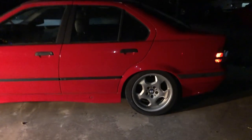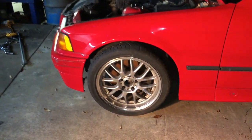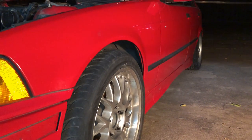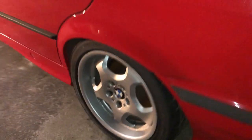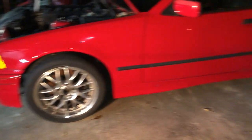Here's what it looks like currently. That's the back with no height adjuster, just the spring and then the rubber pads to dampen some of the vibration and noise — since like I said this is going to be a street car. And here's the front without adjusting anything. Right off the bat I can tell the camber is close to zero, the plates are kind of in the middle. So I'll be slotting those toward negative a little bit and I'm probably going to drop the front maybe about an inch because I want it to have good fitment but still be very functional. It'll probably never be lower than this in the rear because I want to be able to do flares later and clear a big 265.